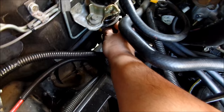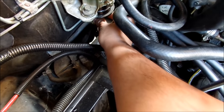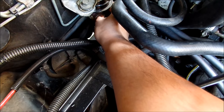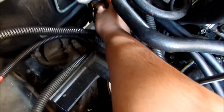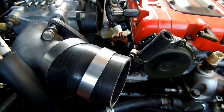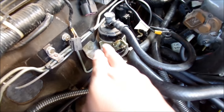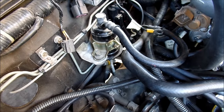I can loosen it by hand already. That was super easy — it shouldn't be too tight, and there's no way you can torque it either. The easiest way is if you disconnect it from the fuel rail. If you're going to take your fuel rail out for whatever reason and you haven't changed your fuel filter in a while, go ahead and do it. A good thing to do would be to mark on the top when you changed the fuel filter.